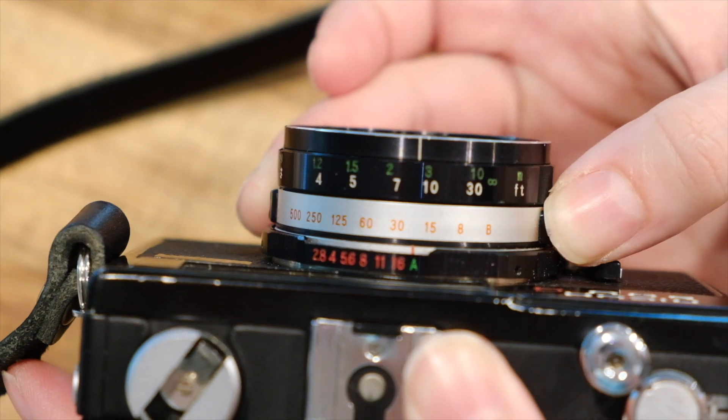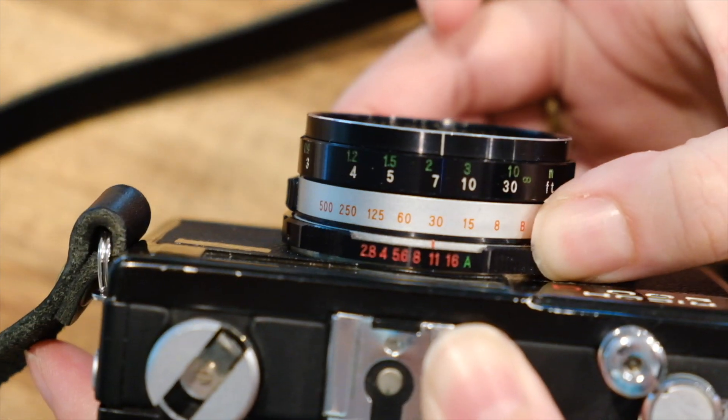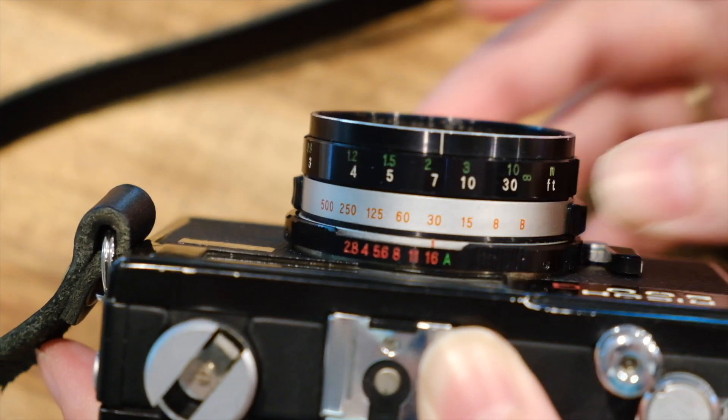The aperture opens up to f/2.8, and one thing I really like is that it has an auto setting — it can be set to shutter priority. If you put the aperture on A for auto, it will choose the aperture for you as you choose your shutter speed. Everything is located on the lens barrel for easy access when shooting, so you can change the shutter, focus the lens, and change the aperture. You can see it all inside the viewfinder — there's a match needle meter on the right side, which is easy and quick when shooting from the car. The meter is located on the front of the camera and it's a CDS meter.